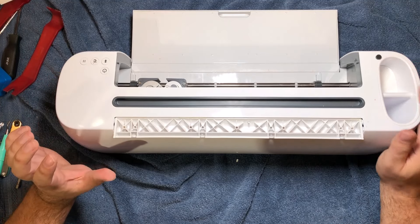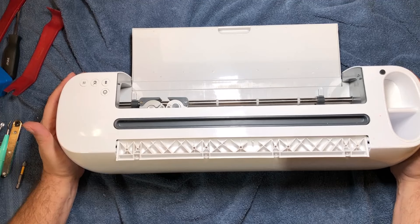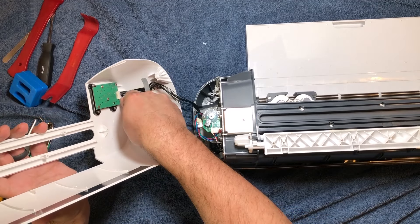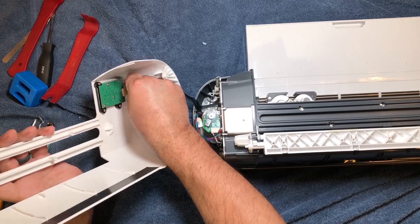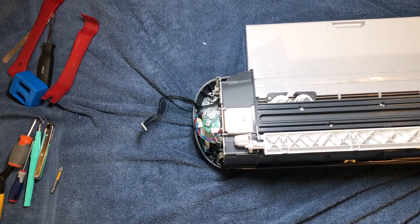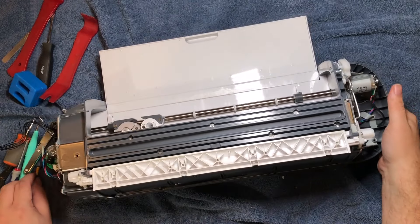I'm going to refer to this as the power button side, because that's what's important. We're going to lift this top off, but we want to get the cord that's attached on this side off first. Lift straight up — it's going to be a little stuck, so jiggle it just a little bit. Set it down and to get this cable off, the easiest thing is to use your fingernail: push a little bit on one side, then the other side, back and forth until it comes out. There will be some tape holding it in place — take that out and stick it back there. There's also a lot of goo on this side, so be careful touching it.